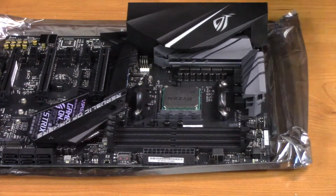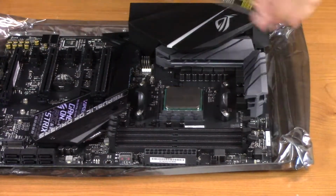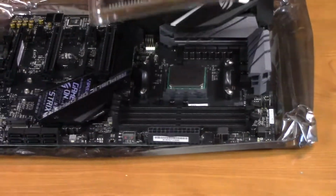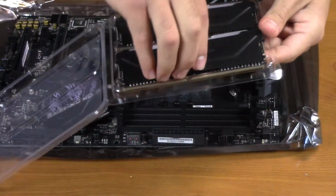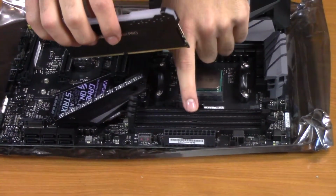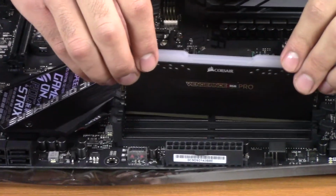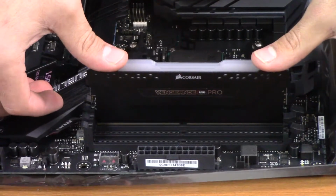So how you would go about doing that is, take a piece out. So just open the case and grab the RAM stick. There's going to be a little notch here. You're going to want to align that with the notch that is usually here. So this, make sure it goes down at the same time. Equal pressure on both sides.